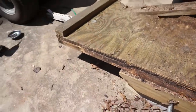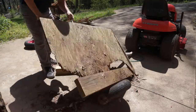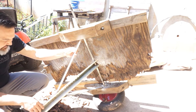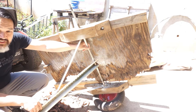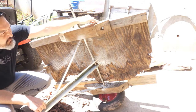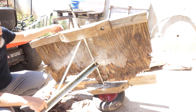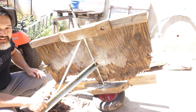Maybe we'll do a better job making sure water doesn't collect on it so it'll last longer, and we might even paint it to give a little protection from the elements — something's better than nothing. Underneath here I used a signpost with some angle iron and a bar stop that we welded to make the frame, and we welded the fixed axle to that. We used lag bolts to hold the 4x6, and then screwed from underneath to hold the base. What we're going to do now is take the platform base off and see what we can do to replace it.